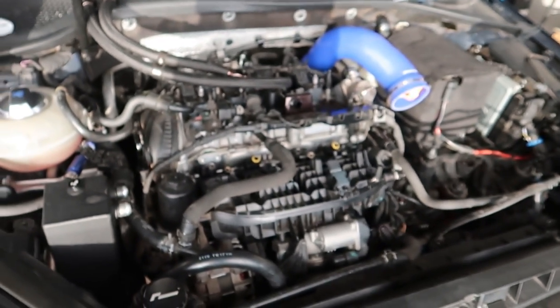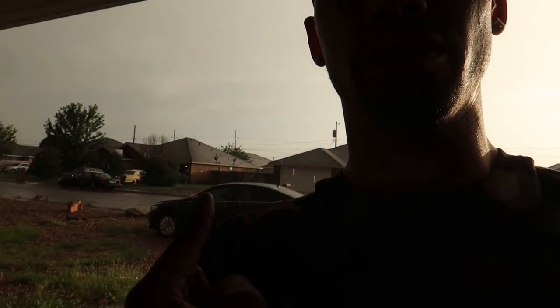Then you got this one and this one on the side - you'll unscrew this, it threads into the manifold. Once you get this off, undo your coupler and the connector for the throttle body, and the whole thing just wiggles itself out. I'm kind of in a rush - I got to be at work in like two hours. I'd like to get this manifold doctored up so it can cure overnight. Jesse's girlfriend's going to let me use her Jetta to go to work. This kind of really sucks - I'm hungry, I haven't eaten today, I was literally about to go grocery shopping.